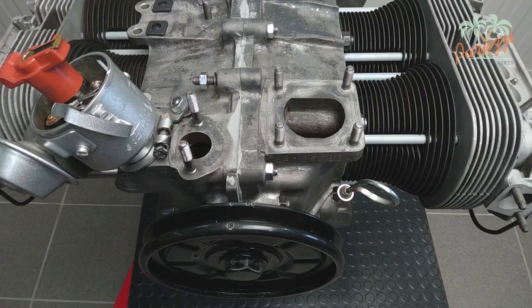If you have an original VW crankshaft pulley, the TDC is usually indicated on the crankshaft pulley by a mark. On our AB 1300 engine, the mark can be seen on the outer half of the crankshaft pulley. On another type of engine the mark may be different or it may not be present at all — consult the workshop manual for your type of engine.